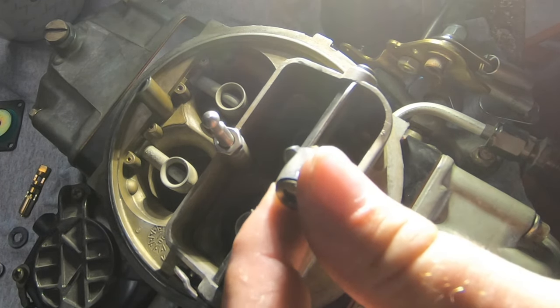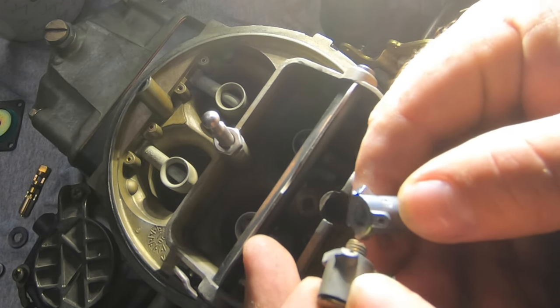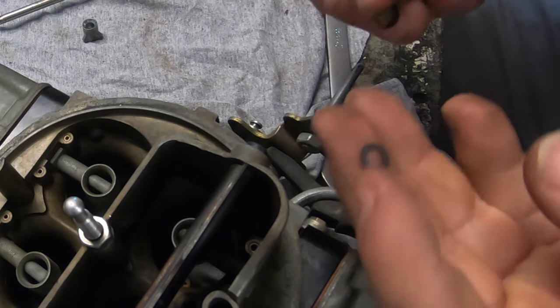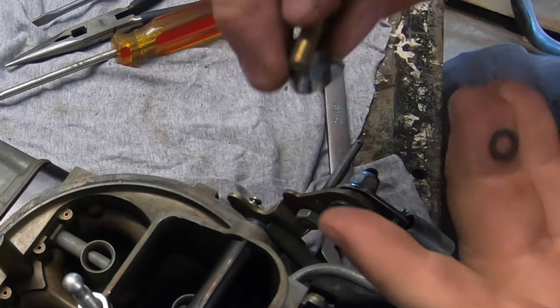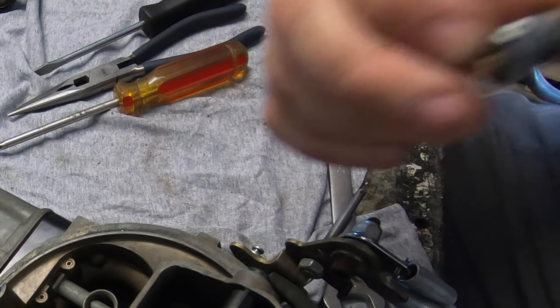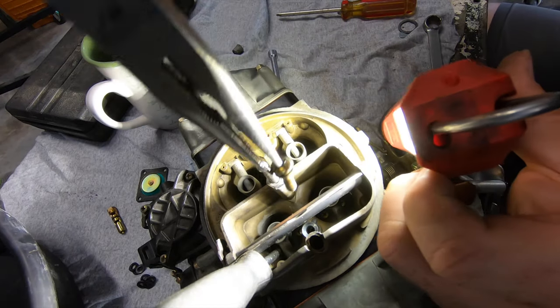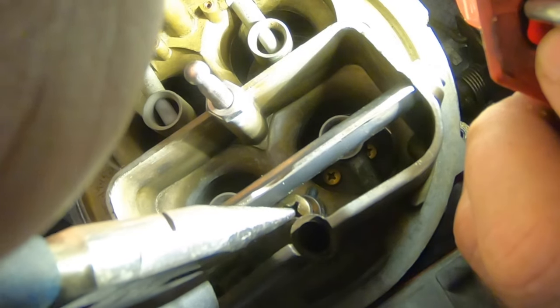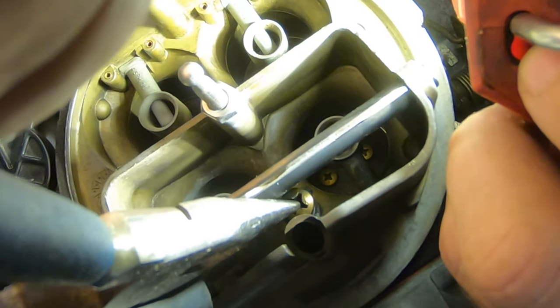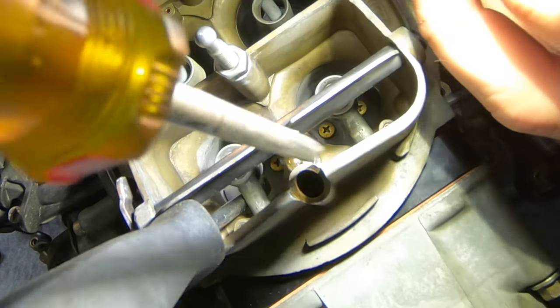The jet we had was a 31 and he sent us a 45 — it's a massive change but we'll give it a try and see how she likes it. The metal washer gasket goes on the screw that holds down our squirter. The squirter goes with the nozzles pointing down and into the bores, then on the bottom we put the other gasket. The trick is getting this whole assembly down in the bore without dropping everything. Get the washer in place, nozzles in place, now the screw — it holds it all together. We're squishing this metal gasket on top so it's going to be a little hard going in, then you'll feel it snug up and that's perfect.